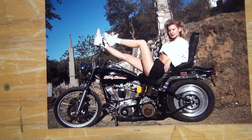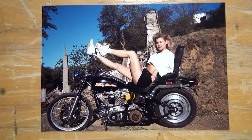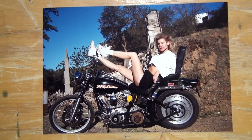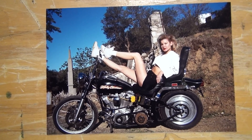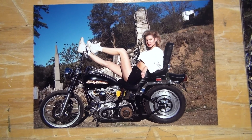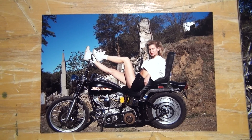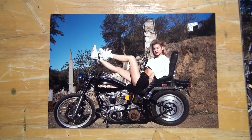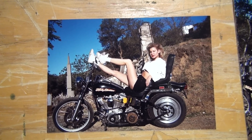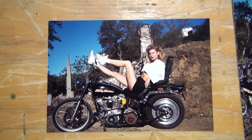It's a stock frame but it has early panhead triple trees, so solid mount on an FLT front fork, which is shorter than a softail fork. But the trees are undercut, so it brought the front end in and actually lifted the bike up in the air so you could ride on the freeways here in LA without hopping all over the road. The front end actually worked — I could do circles in alleys and hop curbs on this bike.